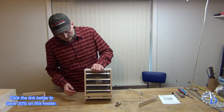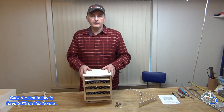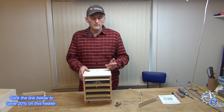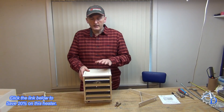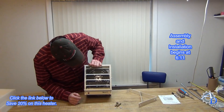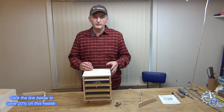If you look in here closely, you'll see a round component that's coiled up — that's the heating element. I was expecting a nichrome wire or ribbon strung between insulators like you'd typically see on electric heaters, so I wasn't expecting this heavy duty heating element. It reminds me of the heating element you'd see in a kitchen electric range, only it's a tubular heating element rather than flattened on top. There are actually two layers — a front and back section — so the air actually goes through two heating elements before it comes out.